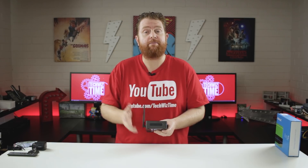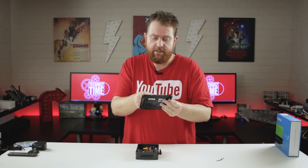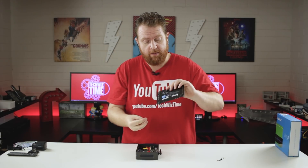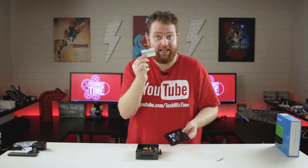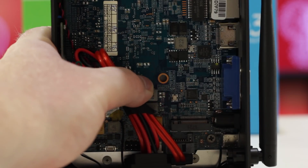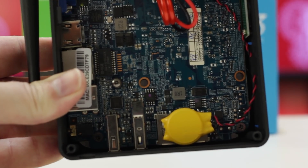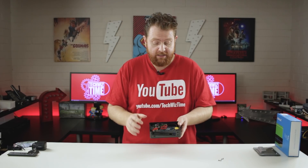On the side there's a grill where hot air can escape the case. Since you can add an M.2 drive, we're going to open it up and have a look inside. Just a note - on the rear there were two screw holes that didn't need to be opened; those bottom two don't need to be unscrewed, otherwise a little metal piece will be floating around inside your case. Inside, we've got the SATA cable and SATA power cable already hooked up. To the side of that is the M.2 slot. You'll also see the CMOS battery wired up and protected. The Wi-Fi and Bluetooth chipset is just there, and the actual CPU itself is underneath the board so it has contact with the top of the case to help dissipate heat.